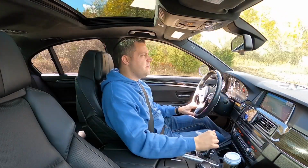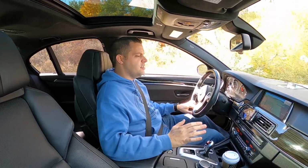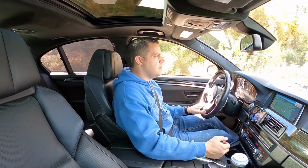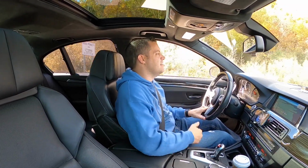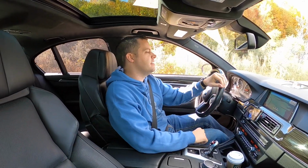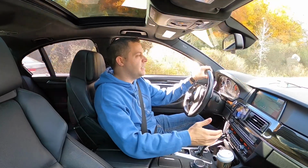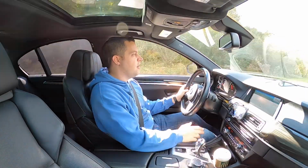Like I said, normal driving, this thing just accelerates that much better. I've been really pleased, even just on map 1, like I said, 4 to 5 PSI over stock, just barely getting on it, it's instant boost, and it feels great. Stock felt really nice as well, but with the JB4 on, it's a big night and day difference, and that's completely stock everywhere else, right? Everything else is stock on the car.